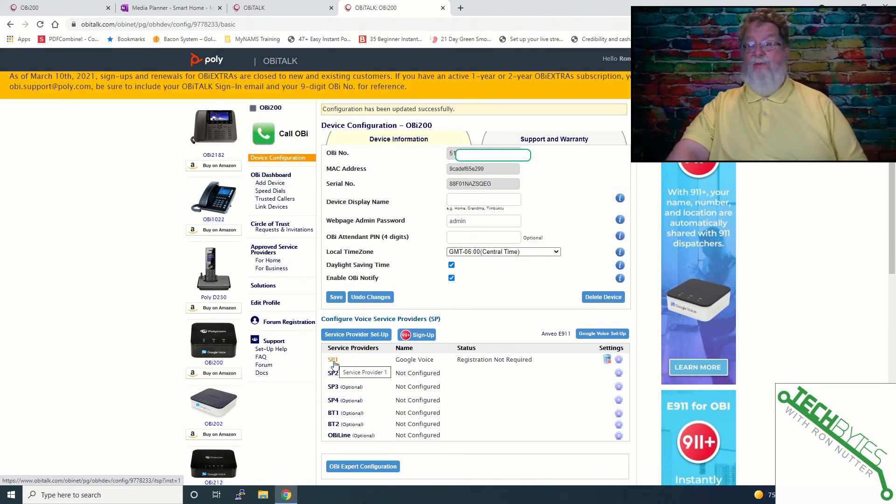I've got to get another device for that to happen. I'm going to try several different ways: one, I'm going to use an ATA gateway to plug in so that I'm using the same analog port on the phone as our single line phone. And then once we've done that — because there are several ways you can tie into 3CX and the OBI 200 — I'll actually try what's called a SIP trunk connection. But anyway, that's all it takes. Very straightforward.